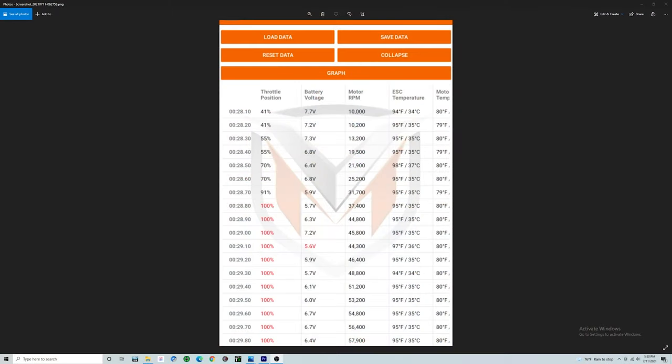Let's switch over to the desktop. If you just go and look at these voltages here, this is just one part of the log where the voltages were getting hit the hardest. You can see that we are dropping down — this was a fully charged battery, fresh off the pack. I even went as far as to HV charge a battery to see if it could hold up by having that extra 0.3 to 0.4 volts on there, and it didn't matter one bit. The battery just got hammered. You can see 5.6 volts here, probably when the turbo was kicking in because I have a 0.1 to 0.2 second delay — so that would be about right — and you can see that it's just getting hammered.